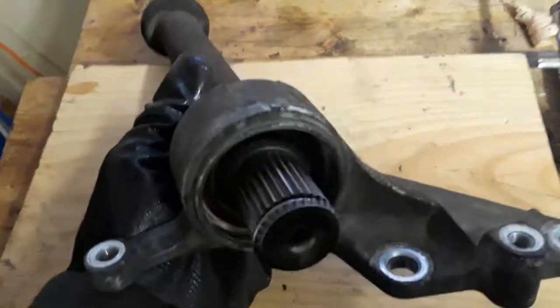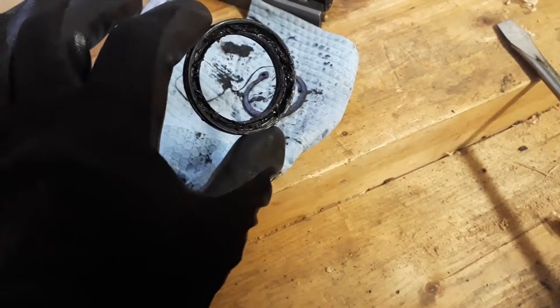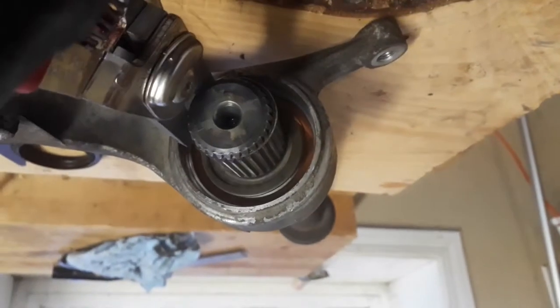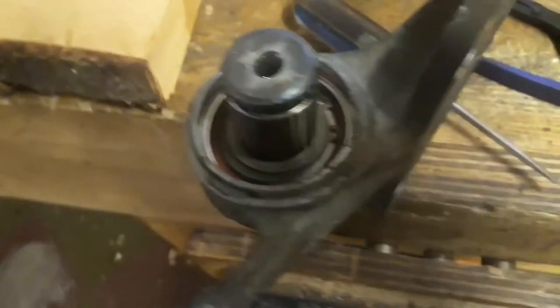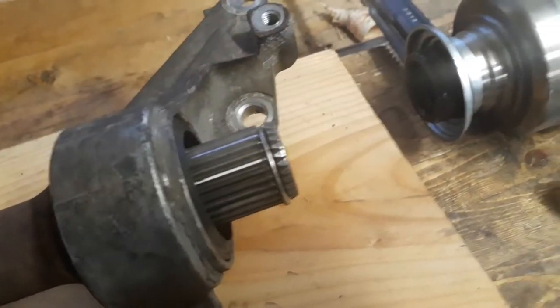Here we have it out of the press. I'm just going to get the snap ring and the seal cleaned up. We should reload this with grease on the inside — get all that old dirty grease out of there, re-grease it and get it ready to go. I need a third hand again. With the second hand, we got the o-ring cleaned up and nicely seated. Now we're just going to put some grease in the back of the seal and put the seal back in its home. With the seal re-greased and pressed back into position, I'm anxious to put these two things back together.